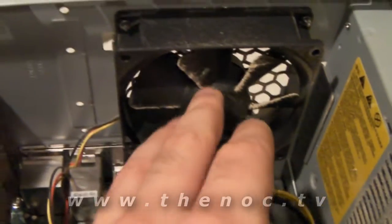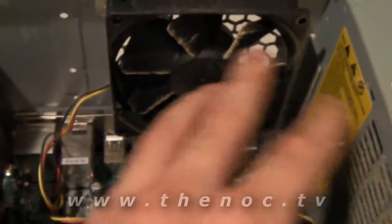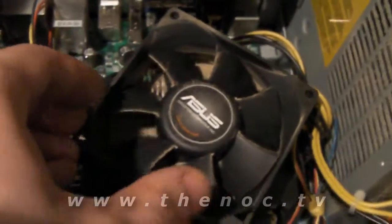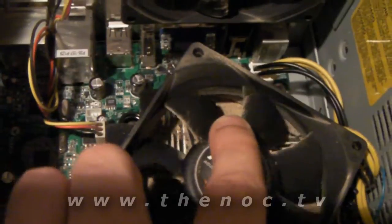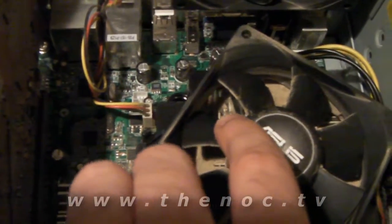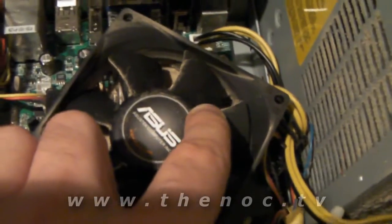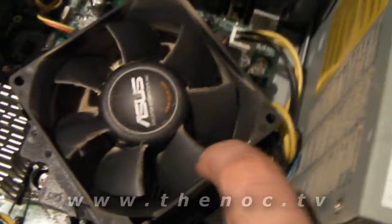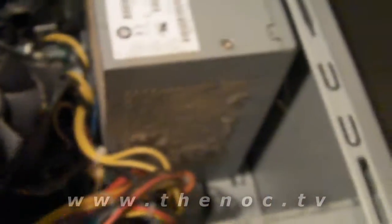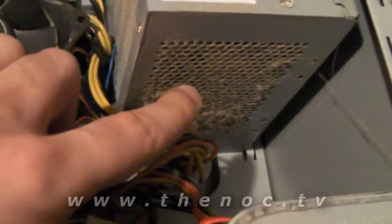Your main fan in the back here — you've got a little bit on this one, not too bad. You can dust that off with a little can of air. The main fan inside the system for your processor — as you can see, it's not supposed to be a solid color. It's supposed to look more like that there, where you can see the fins. This one definitely needs some cleaning. It's about 50% clogged up. And you have the power supply back behind that — it's got some dust clogging, basically the same as the fan.